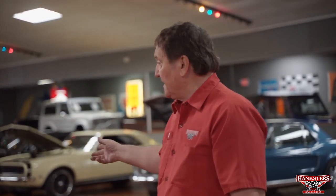We do have a build sheet for this car. It is the correct engine that came with this car with the matching number transmission, so everything matches. I believe it to be all original panels. The car runs and drives as you see it here — it's just an exemplary '69 Plymouth Roadrunner in one of the best color combinations with the best wheel and tire combination. High option car: it has buckets, console, light package, tinted glass, and power steering. The cooling system has been upgraded from the conventional radiator and fan with shroud to two electric fans on an aluminum radiator with a thermostatically controlled system and an overflow bottle. Everything's fresh in the motor.